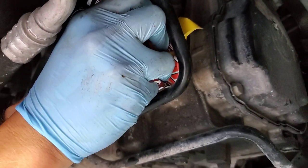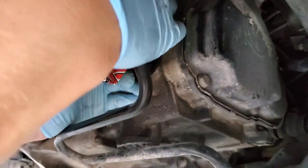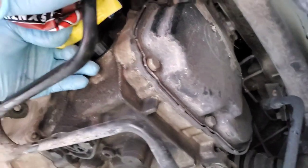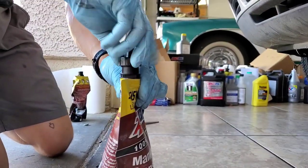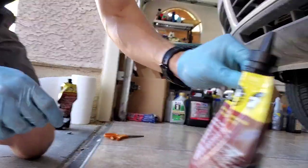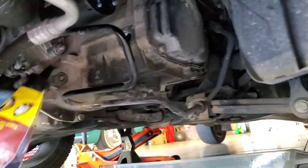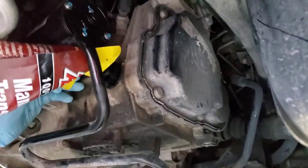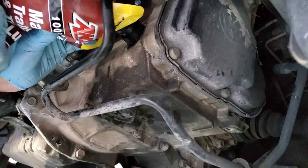What I usually do is mushroom the pack and then squeeze it like a tube of toothpaste — you'll get it all out. This holds about 2.1 quarts. It should start to overflow right now. We're going to fill it until it overflows and then drop it level to make sure it sits level, because it's not good to overfill your differentials or transmissions. Don't be shy with it — you won't burst it, just squeeze it hard. Let it overflow.